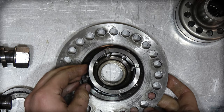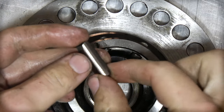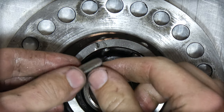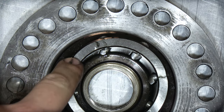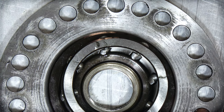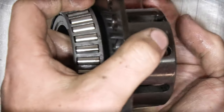The pawl carrier is what holds the chiclets, or pawls, or whatever you want to call them — they're just little metal rectangles. This gearbox has had a hard life so they're not an ideal example of what they should look like and they will be replaced. There are eight of them sitting in the pawl carrier, with the outer and inner races driving against one another. The drive comes from the pawl carrier which is attached to the crown wheel.